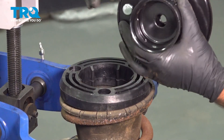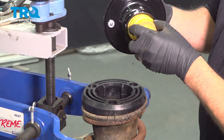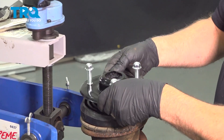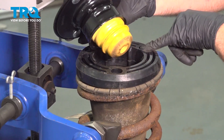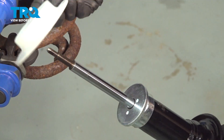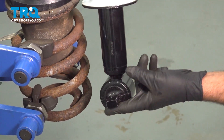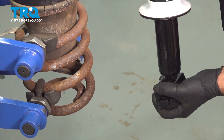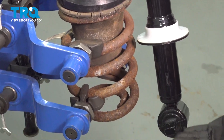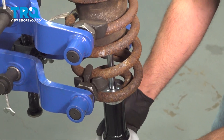Push that down. Now put the bumper in underneath and lock it in place. Line this top up — there are a couple of dimples underneath here that line up with those slots. Put this spacer on and line this up. It's slanted, so you want this towards the center stud, going towards the back. If you took the old one off, take a look at which direction that angle was at. Then slide this up in place.